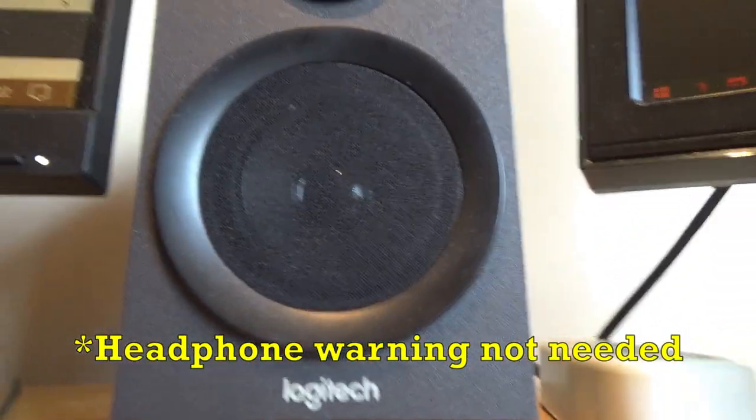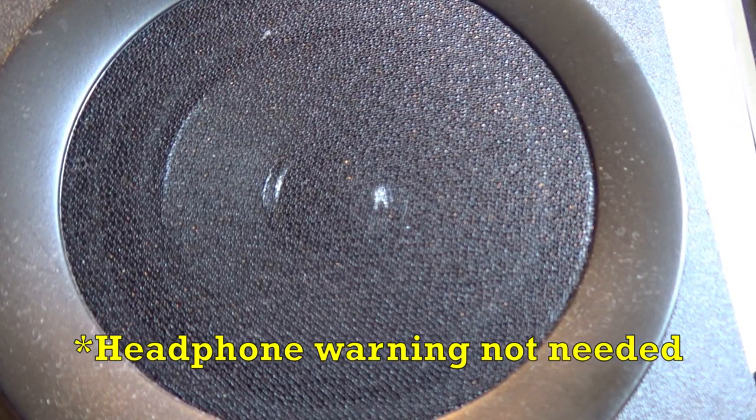So the left speaker is able to receive and output the signal, but now moving over to my right hand speaker, if I just put the camera in roughly the same place. And it sounds like that. Now I appreciate you may have been able to still hear the left speaker, but if both speakers were receiving the same signal they would be equal volumes — and I can tell by looking at the microphone monitor on the camera that there was near enough no sound outputting from the right hand speaker.